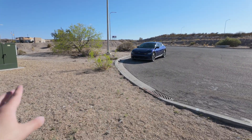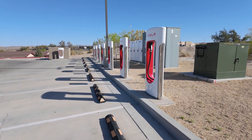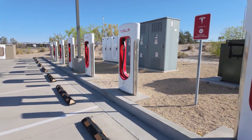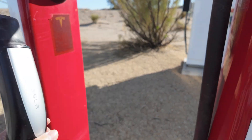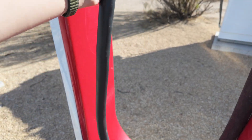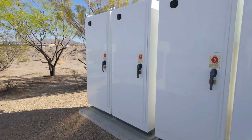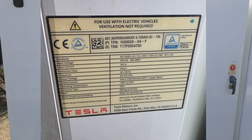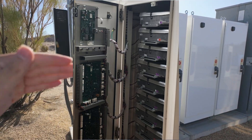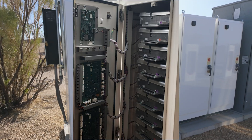There's my car back there, and we're at a fine example of a Tesla version 2 Supercharger. None of these version 2 Superchargers will be open to any third-party EVs — they are obsolete even by Tesla standards. How you can tell: this cable is air-cooled, not liquid-cooled, makes a different noise. You have the silver ring — silver ring means it's version 2. These are version 2 cabinets. These are essentially a stack of Tesla Model S AC-to-DC converters, the onboard chargers of the Tesla Model S, stacked in line. So this is kind of not really purposeful hardware.